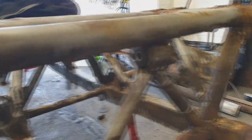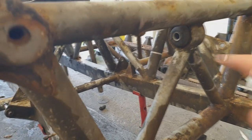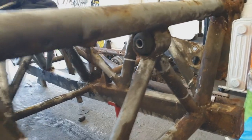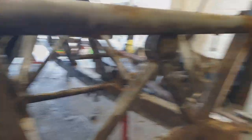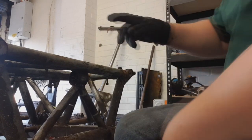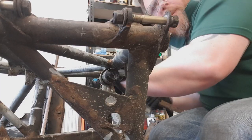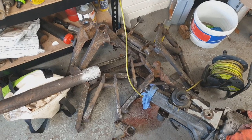Now with everything that can be removed from the car done, there's one last bush we need to address - sadly it's on the chassis. Our last bush is this contentious little guy here that holds the back of the diff into the chassis. We're just going to heat the rubber until it falls out with force, and then we're going to put a cut here and a cut here on the remainder. We've used the hacksaw to very slowly and very painfully cut a wee groove on the bottom of this. Much like the front diff bushes, we're going to try and just break it and make it fall out. And that is one big pile of bush-free crusty stuff.